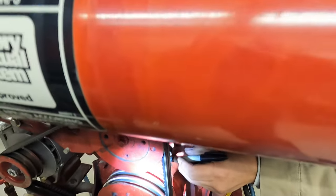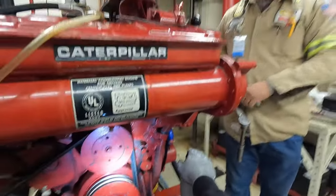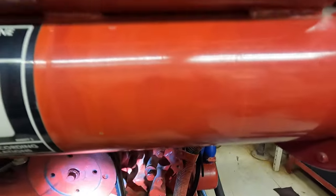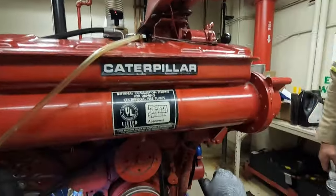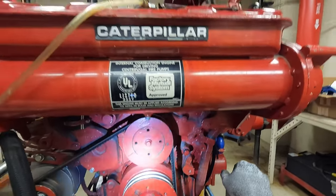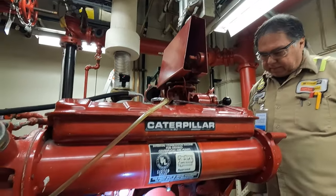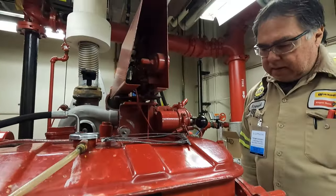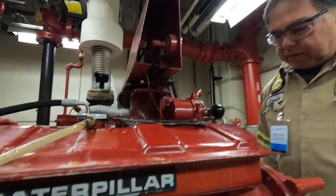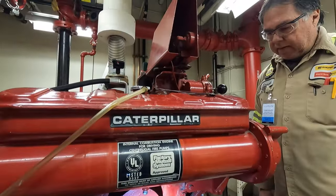It's retarded just a little bit. Usually what we used to do is advance them a little bit — but that's when you're trying to make total horsepower. See how it's got the pointer and the tip, and then the TDC mark? We used to put it before top dead center — put this mark at this edge — and that would advance it. That's what worked for altitude, like New Mexico — Albuquerque at 5,000 feet. We used to set our pumps half a hole before top dead center and they'd come alive — build boost and horsepower. That's just years of doing this.